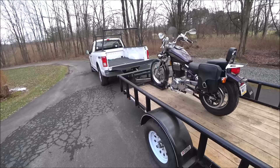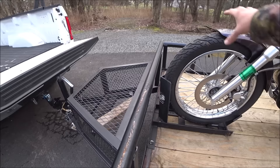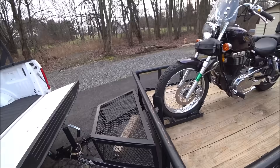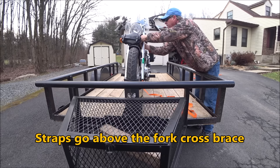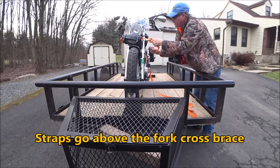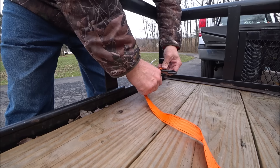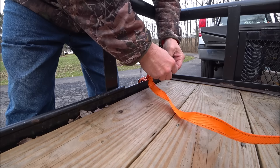Now I'm gonna put some straps on. You'll notice when I put this wheel chuck in, I put hook bolts in the front of it so I can put my ratchet strap here, come up and go over — that just gives me a little more security in how I'm strapping the bike down. I'm going to put this down for now, move this bag, and just put the strap around it. Remember not to strap it on to the fender — just strap it on to the crossbar. So what I do with these is you can either go through the bottom loop and go over the top of the hook. That'll keep it nice and tight.